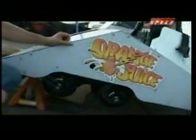That gives us 2,600 amps at 240 volts. We feed that to two motor controllers with a maximum output of 2,000 amps each. That goes to eight permanent magnet motors. We have four-wheel drive on the back, so this is a six-wheel dragster. Two motors powering each wheel, each motor capable of about 30 to 35 horsepower — about 360 horsepower total. The trick is keeping that to the end of the track.